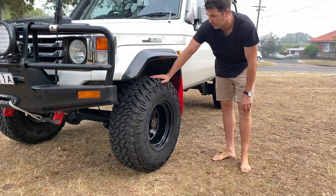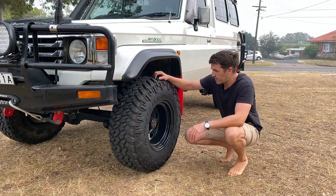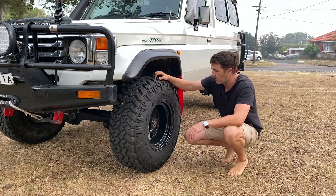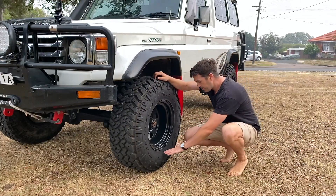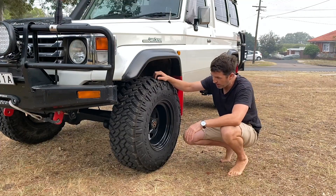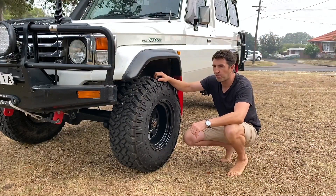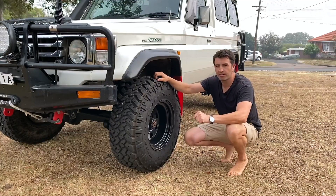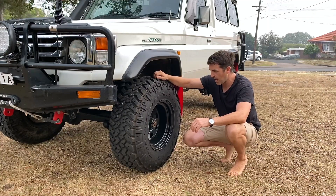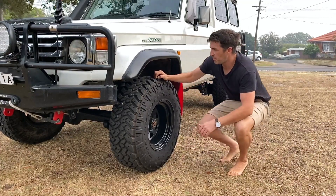I was at Blacksmith's Beach a few weeks back — I'd never driven on that beach before and apparently it's really soft sand. I dropped down to 14 psi and it takes a lot for them to bag out; they've got a really strong sidewall so I had to go right down to 14 psi and even then I thought it could go lower. It didn't struggle in the sand but I did find it a little bit harder going — I don't know if that's because of the heavy tread pattern, or because it didn't bag out, or because the sand is really soft there.